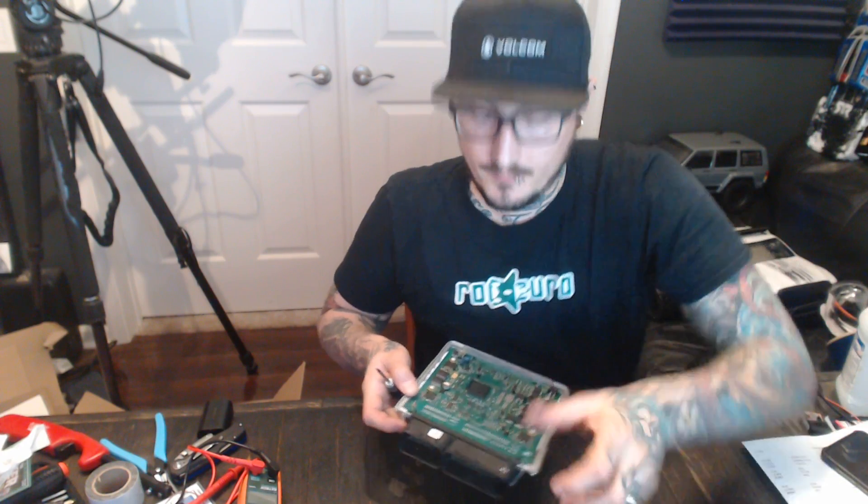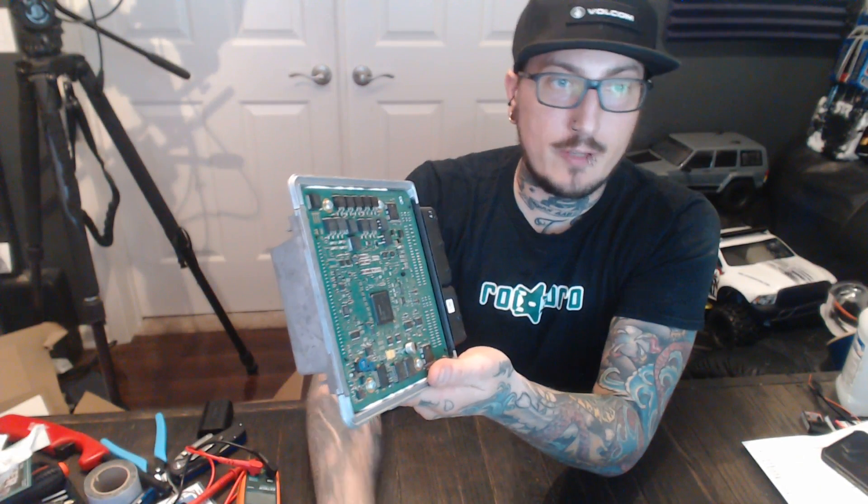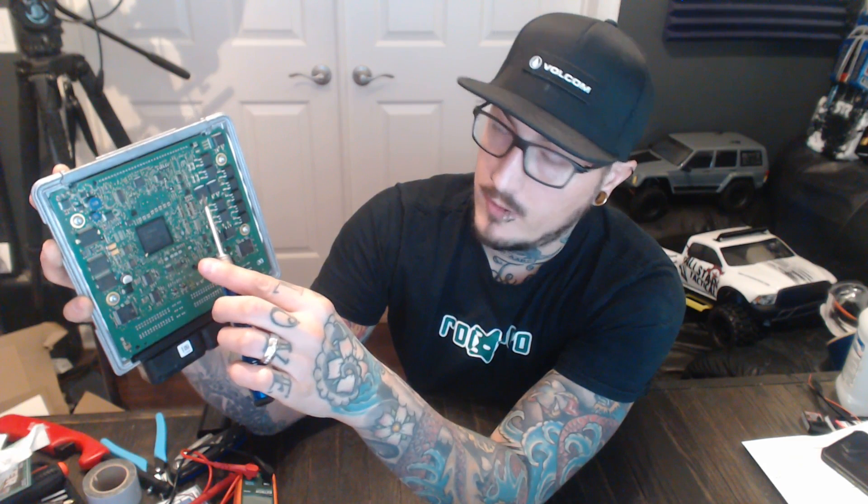Once you're inside you can see the transistors — the MOSFETs up here — these are your important ones. You have six MOSFETs, one for each injector. With the connector facing down: this one here is injector one, injector two is right below it, injector three is right next to it on the corner, injector four is straight up on the other side, injector five is one down, and injector six is up there.